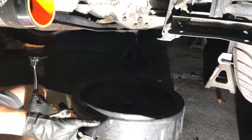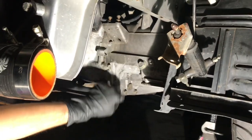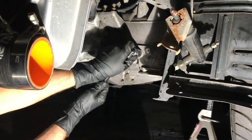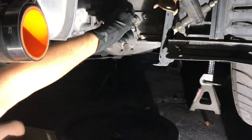Alright, the cheater already got the nuts loose here. So we got your fill plug here and drain plug on the bottom - you got a 17 and a 24. We're just gonna crack these loose so it'll let air in when you drain it so it's not burping.